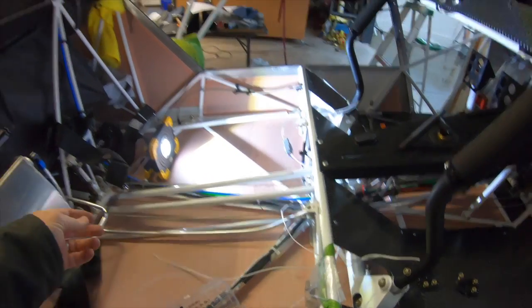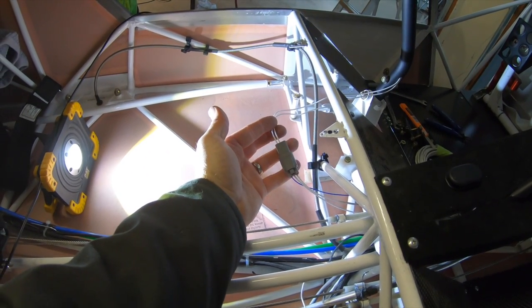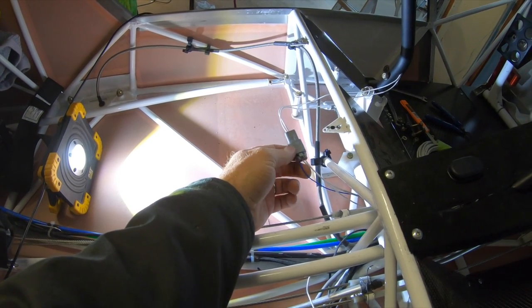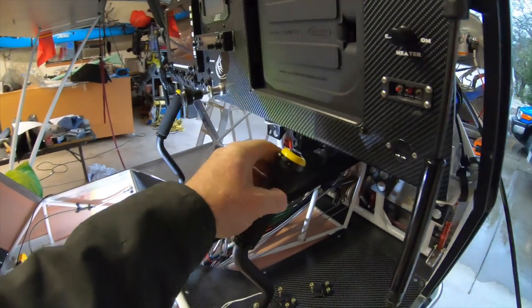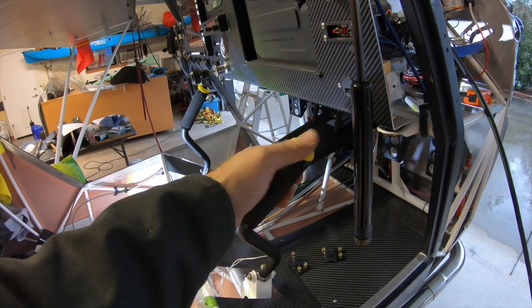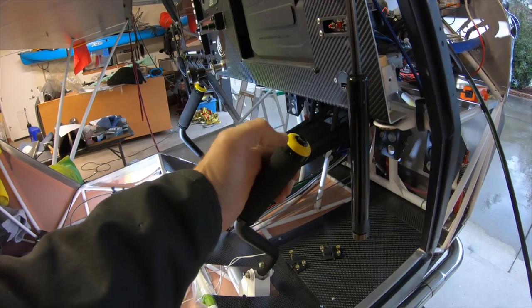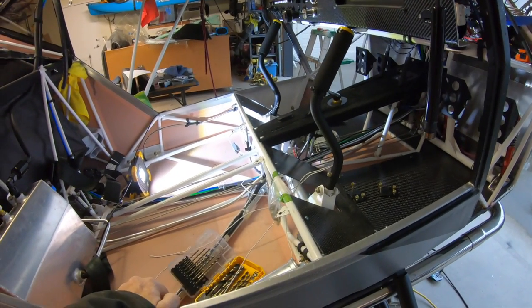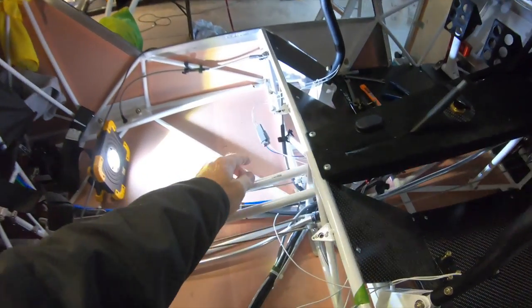I'm going to order a two-pin Deutsch connector, then I'll put that in. The other side has a three-pin — I did have one of those. So two wires are currently running up the stick, and to that pin I've got a third wire, and that's for an autopilot disconnect button. I still plan on at some point redesigning the top of these grips to have a trim switch, an optional switch, and a push-to-talk switch so that you can have the autopilot disconnect and also a trim switch. I won't get to it until after I'm done with this build and the flight testing, so don't hold your breath on that.